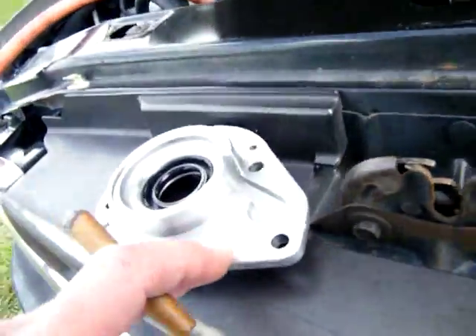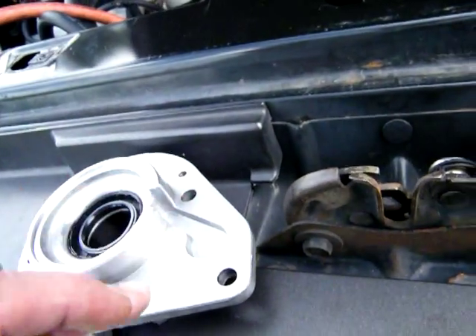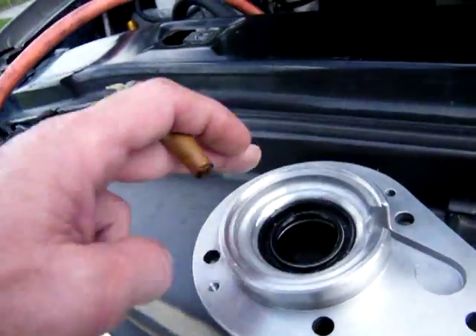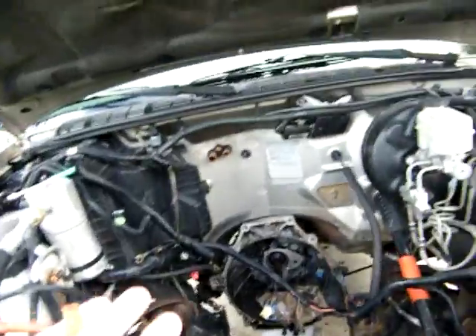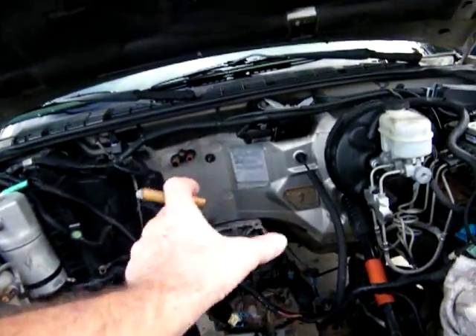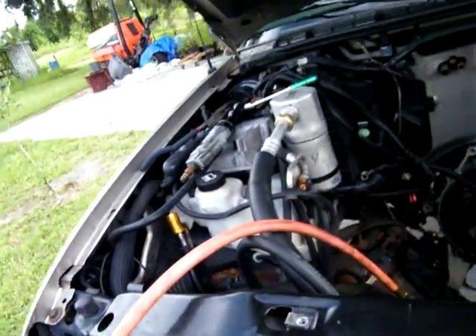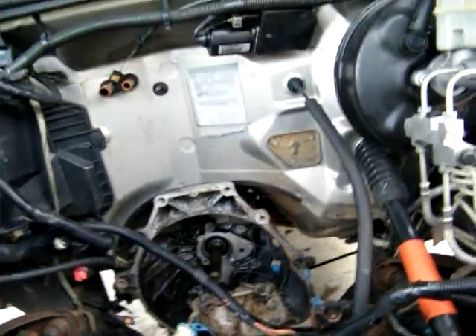All it takes is that right there — just put a little film around it, not down in here but all the way around the outside, a little bit around here and there. Stick it on and do a twisting motion like this when you're pushing it over the input shaft, and then I'll put the new slave clutch in. I should have all that done today.